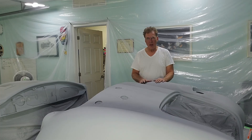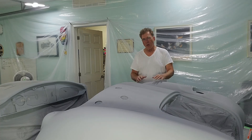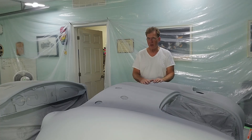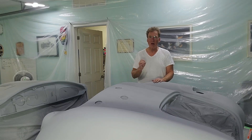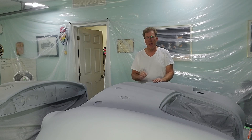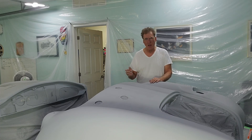When you get near the bottom of the can — and we've gone through a whole gallon, putting three coats on originally then cutting it down to one or two, and now another couple of coats — those solids near the bottom were thicker than I thought. Without straining the paint, I put it into my DeVilbiss gun, pulled the trigger, and barely got four seconds out of it before a glob got into the gun and shut it down.